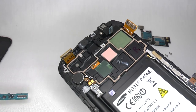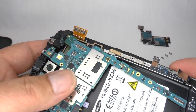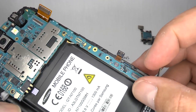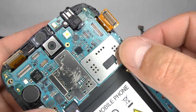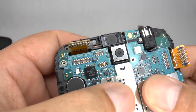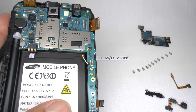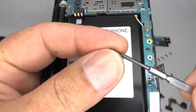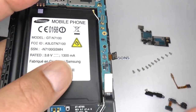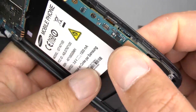Now we can replace the main board. Make sure all the ribbon cables are open and that nothing's being trapped underneath. Make sure the antenna cable isn't trapped, and everything looks like it's sitting down nicely. Once you're happy that it's sitting down, we can replace that single black screw — just finger tight. Now we can reconnect all the cables — line that up and snap that down into place.